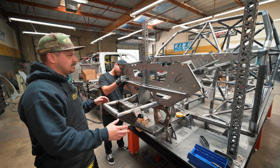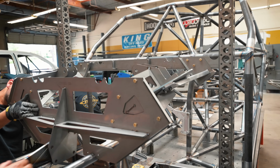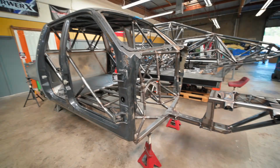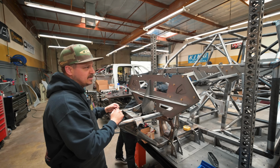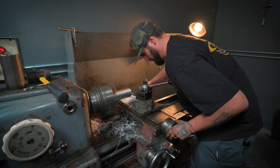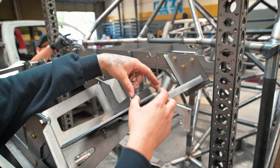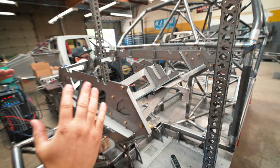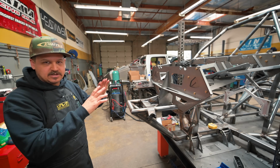And then basically we just locate the shock mounts and where all the tubes need to go. We cut out an extra set of this fixture, so we'll be able to bolt it to the gray truck and the Tundra to do all the front shock mounts and tubes on there as well. And then Max right now is machining a sleeve for the bump stop, so a bolt will come through here, bolt to an aluminum sleeve, and then the bump can will be here. That'll locate the bumps and everything, so we'll be able to just fit all the top tubes, and then everything's basically done.